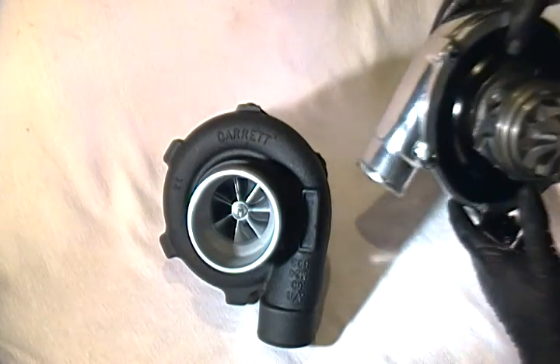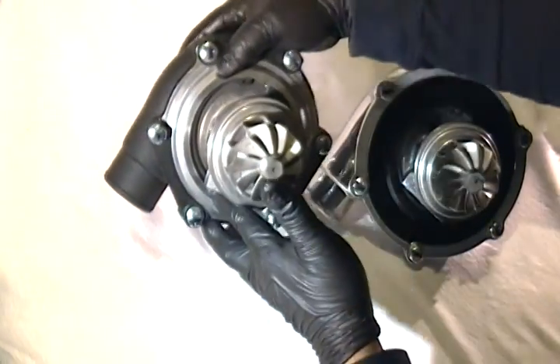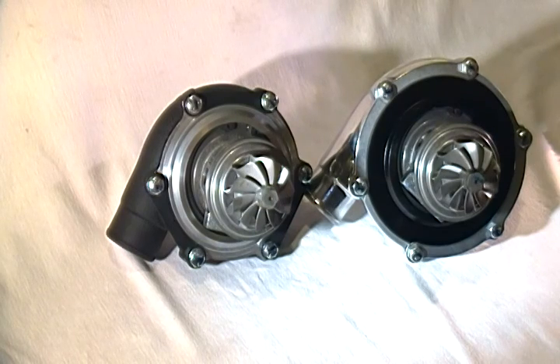The similarities are mainly in the turbine wheel, as both the TR-3030R and the Banshee share the N111 60mm turbine wheel that's also shared with the GT3076R, GTX3067R, and GTX3071R. If you already have one of those turbos and want to upgrade or downgrade, there won't be a change in the turbine housing unless desired, allowing you to fit this cartridge with the double bubble shield into your GT3076R.